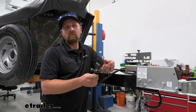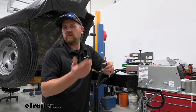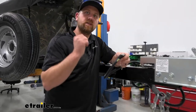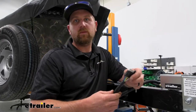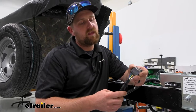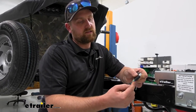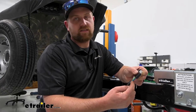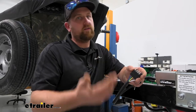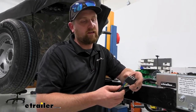What some people also do is on smaller utility trailers, some people like to put reverse lights when they're backing up to a work site or whatever the case may be. You could hook up your reverse lights to this signal. Granted, it's not going to put out a ton of amperage, but if you've got a couple of LED lights, it's going to be more than enough. And that will work.